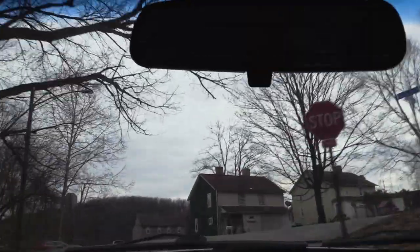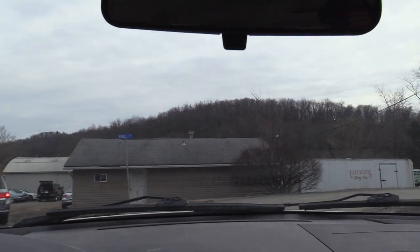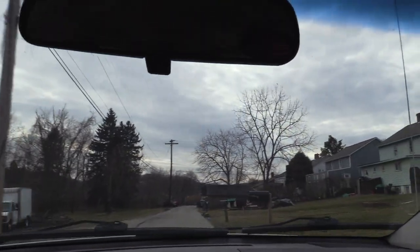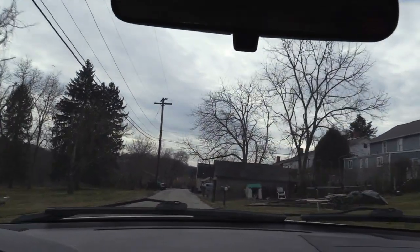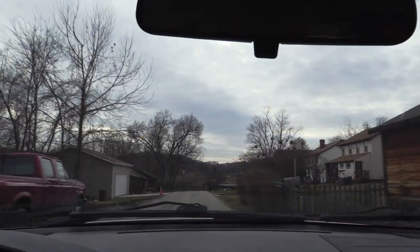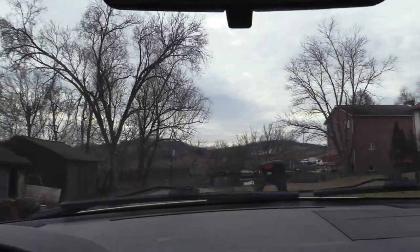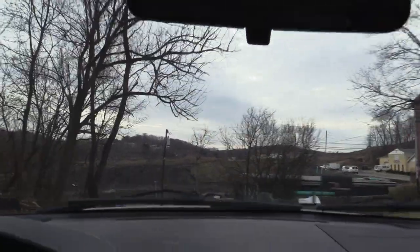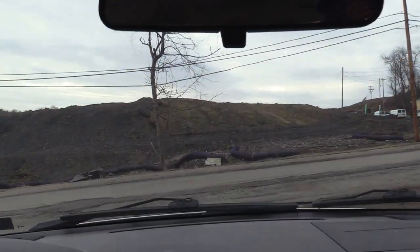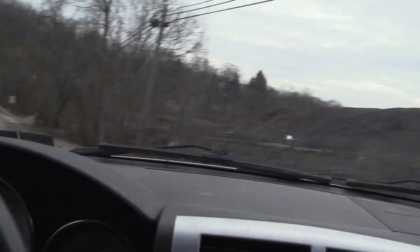That's a pretty nasty surge right there. I need to drive this a little bit more. Did not like the way that felt. I just need some guidance on what that is. Is that the output speed sensor making it do that? It certainly could, but I'm not seeing the speedometer drop out. But I've seen cars where the transmission output speed sensor doesn't control the speedometer, and it's the ABS wheel speed sensor that does. So you don't want to base everything off the speedometer.